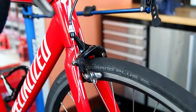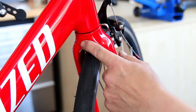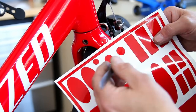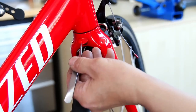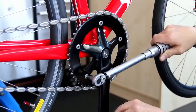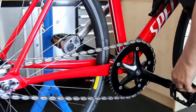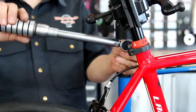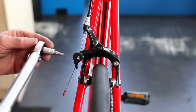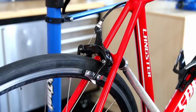And here's the little trick I mentioned — we're just going to put one of our vinyl detailing stickers over the bolt hole in the fork so that you can keep that hole nice and clean, making it easier to remove the front brake in the future. We continue torquing through the bike, getting everything spot on. Another loose bolt on the saddle, so just another tweak there — we run right the way through the bike.